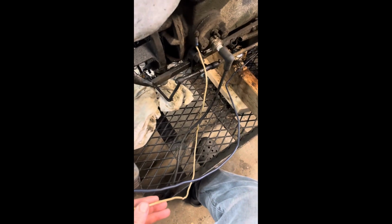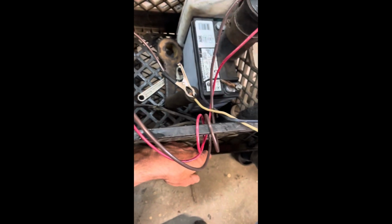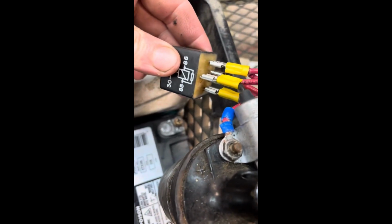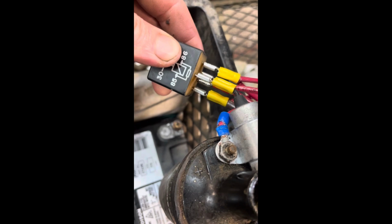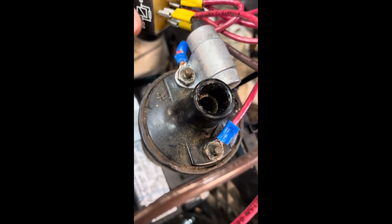So once you have your coil made and put together, you're going to take your ground wire from your block and you're going to clamp that to your negative battery cable. So your negative battery cable clamps from your engine block ground, runs up to post 85 on your relay, which then jumpers over to the negative side of the coil with the ring terminal. Then you're going to take your wire from your breaker point, and that's going to get hooked directly to the negative on your battery.